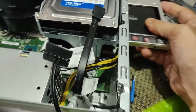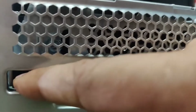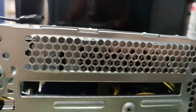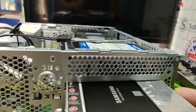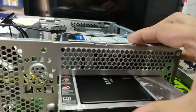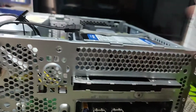Slide it gradually in. One thing to keep in mind when you have removed the hard disk, there is a small notch. So this is a groove, you can see. So you have a notch over here. When you remove it using a plier, you can just stretch it downwards, else this caddy moves in a bit tightly. So once you do it, you can feel it. This caddy needs to go in pretty easily without much pressure. See, it's slid inside.